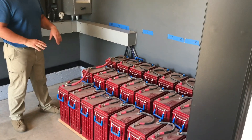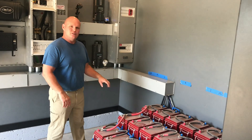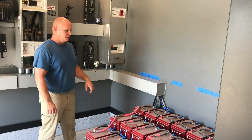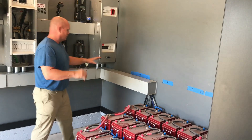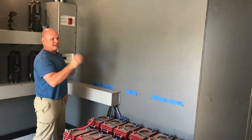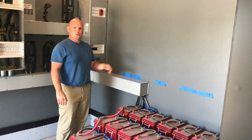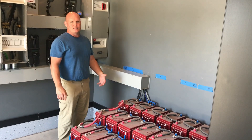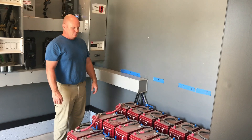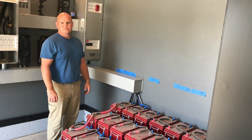These are some batteries I pulled out of a project that had a little life left in them. The lead acids I had were starting to lose some cells — I was really hard on them early in the project — so these bought me a little time, but they're also at the end of their life. The next step is to remove the three-foot gutter and put a two-foot gutter in here with some conduit work. The IVR3 will mount in the center and I have plenty of room on the right-hand side for our new Skybox — Outback sent it to us and we're beta testers, so we're excited to give you guys updates. So enough talking — we're going to hook up the GoPro and get you some video of the install along with tips along the way.